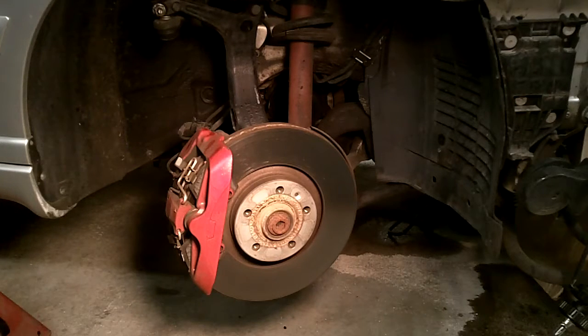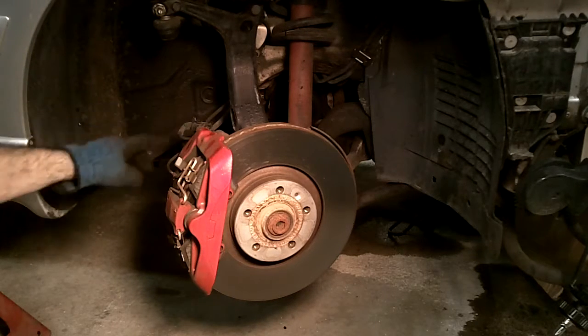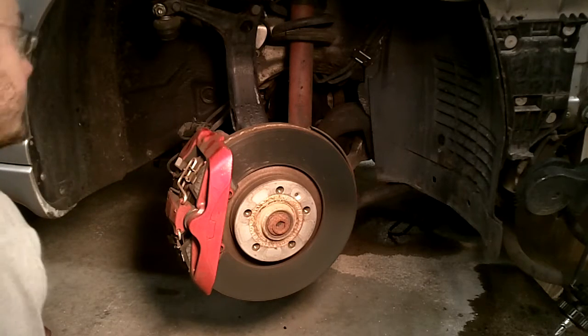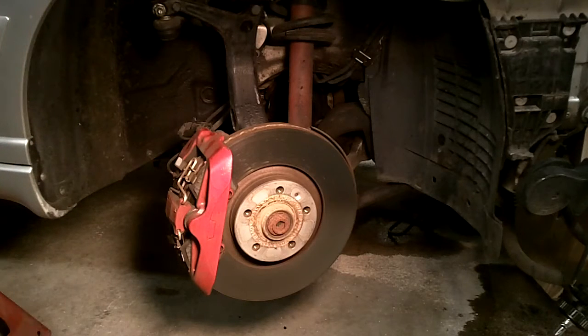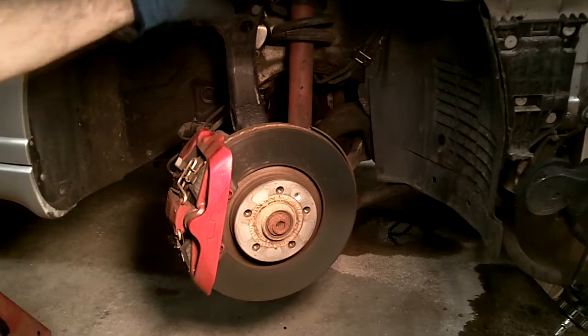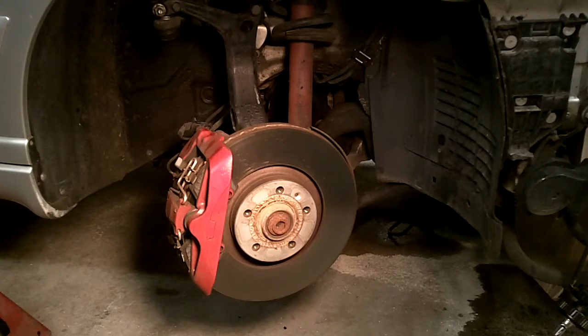After that, I'm also going to go over removing the sensors. So we have the brake pad sensor here, as well as the ABS sensor. So that's around the back side here. I'll show you how to do that, as well as which bolts you need to loosen up in the engine bay from above to loosen and disconnect the strut. So here we go.